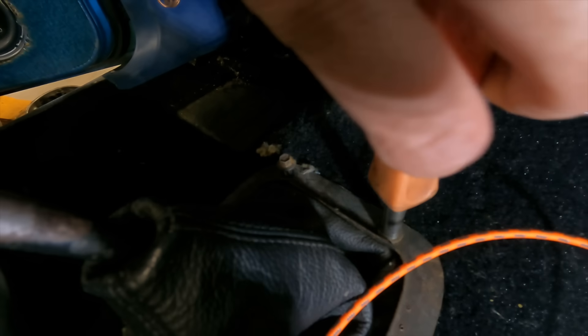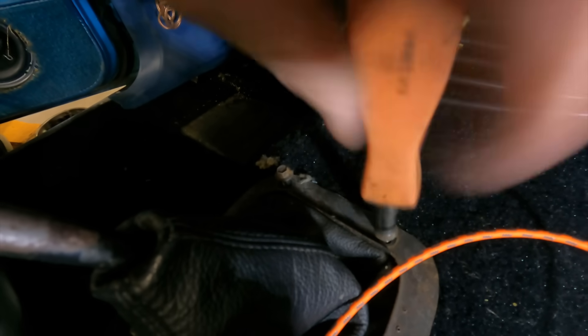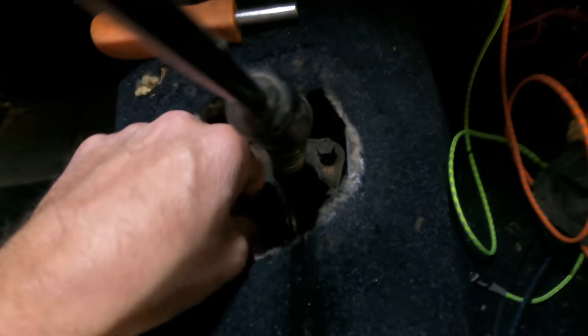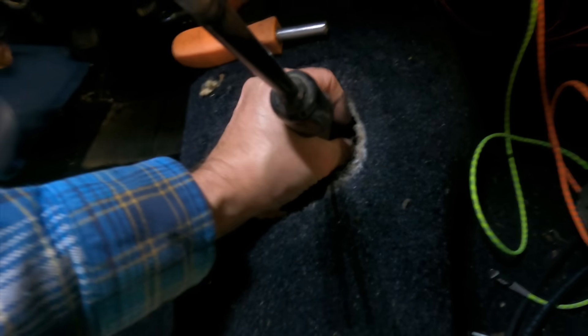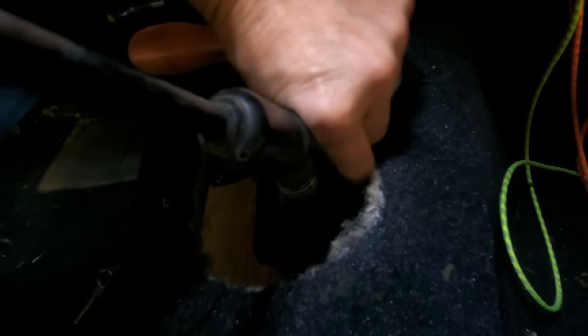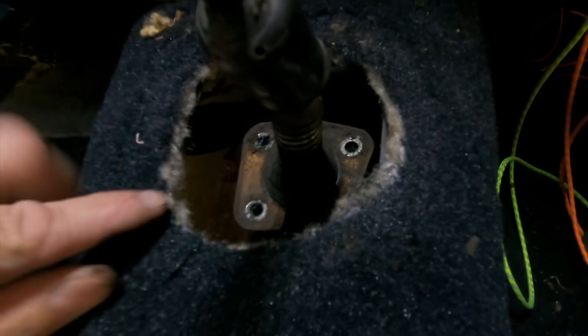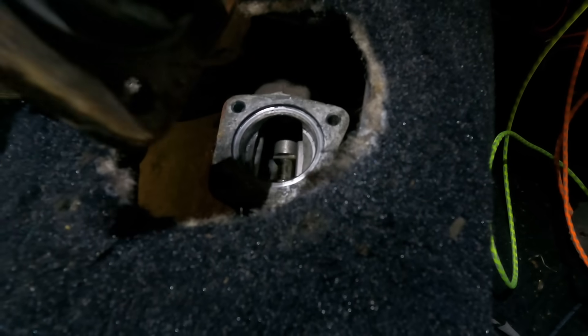There's still mouse nest stuff like everywhere. I think I probably need to just get rid of this whole carpet kit — it looks nice and new but I think it's nasty, pee-soaked mouse-smelling grossness. These three bolts hold the retainer plate that the shifter pivots in, so this style should just lift right out. There are other styles like in Jeeps and Toyotas where there's a spring and ball you have to push down and move, but this one just unbolts out of the top.